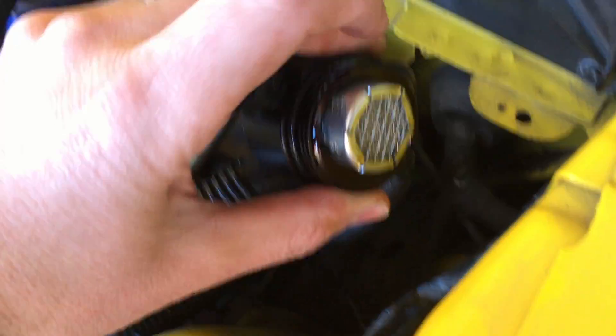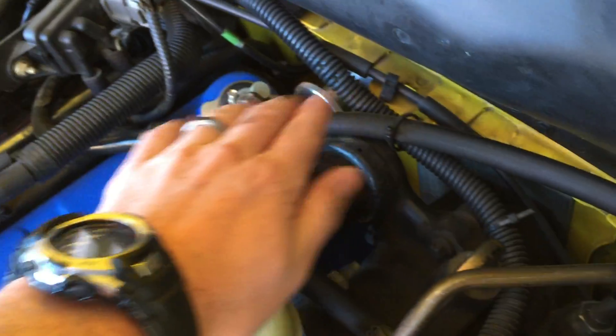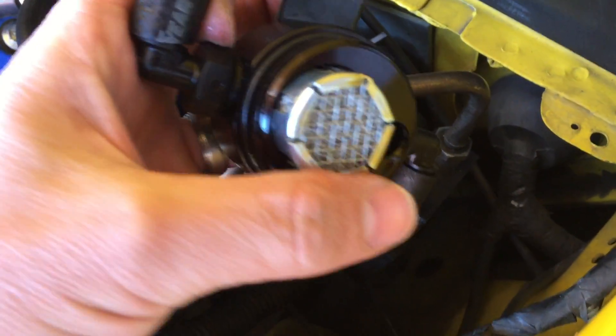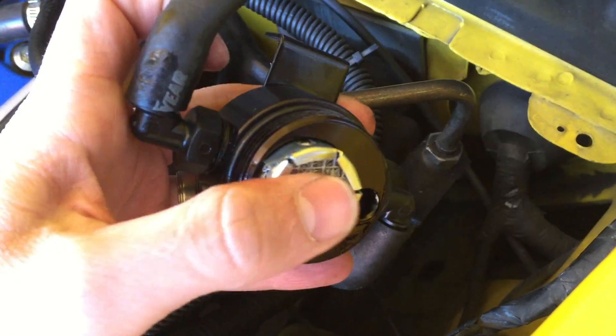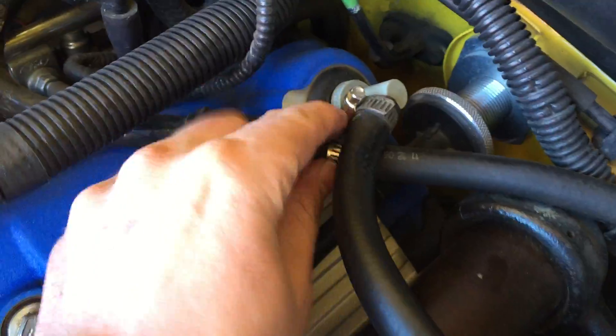As the supercharger or intake manifold, depending on your setup, is breathing the air back into the intake, you want that to be on the side that has the filter. So the oil drips down into the catch can and then as it's being sucked back up it gets caught in this filter, and then the air will flow through and go back into the intake manifold.